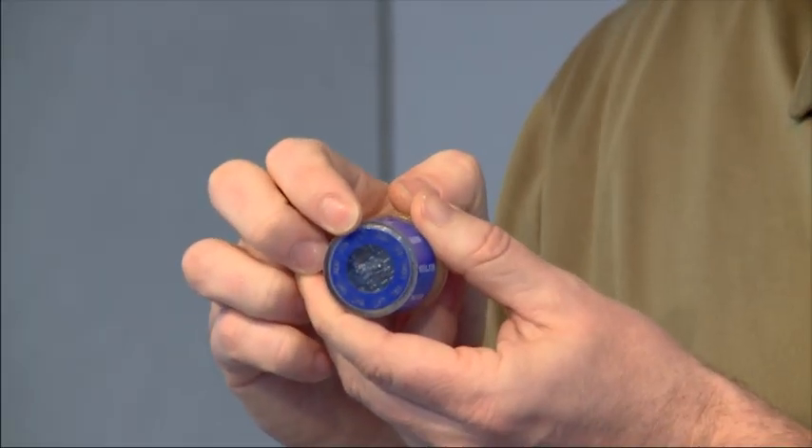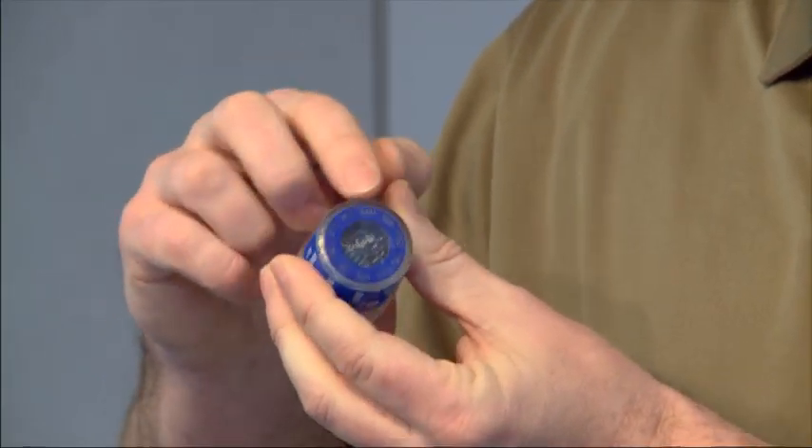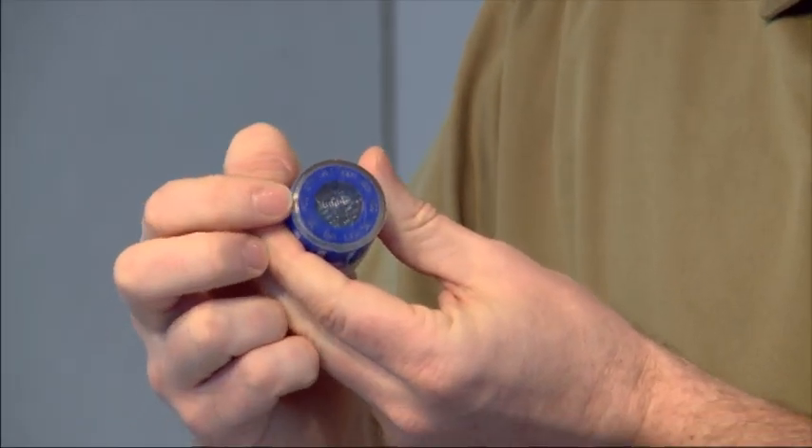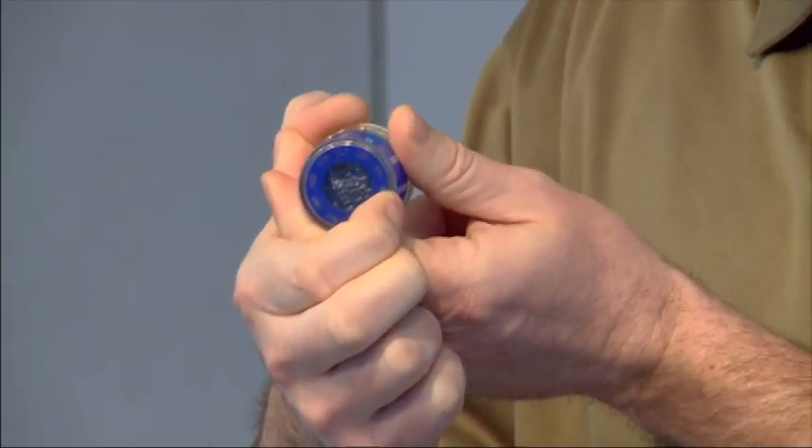Typically when you plug it in, if there are no faults on your truck, the LEDs will show a green voltage lamp and that's all. Don't call up the Bendix tech team and say you've got a green lamp — that means you're okay, you're powered up, and your ABS controller is on. If you have a fault — for instance a speed sensor fault — you will have a light that says 'sensor' and a light that tells you which wheel end you're looking at, such as left front.